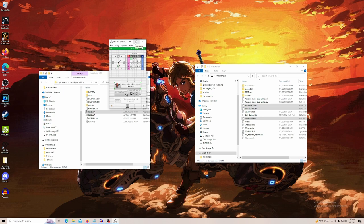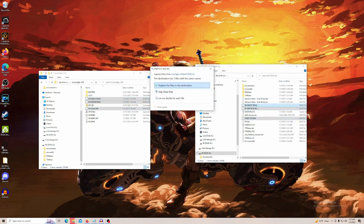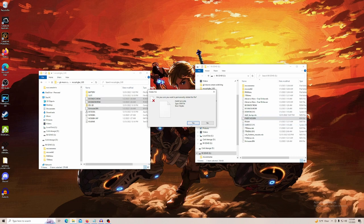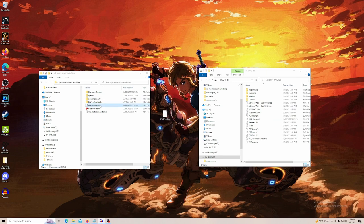So now we're going to take that, put it back to our DS, and for that we're also going to need another program. So let's take these, move them back. We're just going to replace the two. And then I believe we'll make an extra copy of this one. Just going to drop it on the desktop for now. And then we'll delete it off here, just so we don't get it mixed up. All right. So we're going to move this firmware manager, the Nintendo DS version, drop that onto our R4, and then we're just going to eject it and head back to our DS.